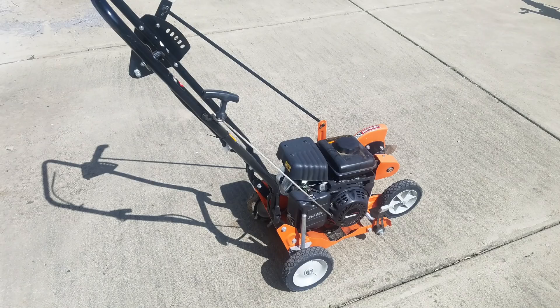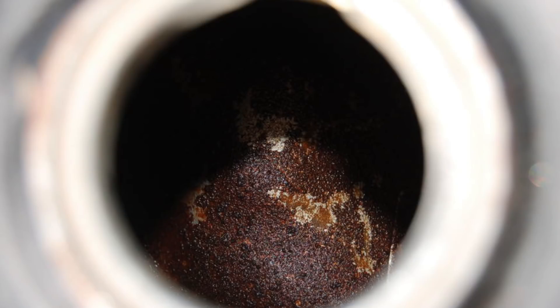The reason I was excited to see that ethanol-free gasoline is because it's almost spring now in Buffalo. I went out to start my lawn mower and my edger, and I had a problem — one of my lawn appliances didn't run. Something unique about it led me to think about the gasoline. The lawn tool is an edger and it has a metal, steel gas tank. When I took it out it wouldn't run. I drained the tank, looked in the bottom, and it's full of rust.